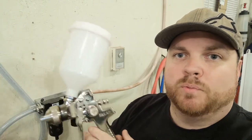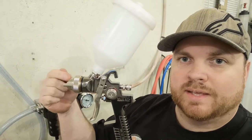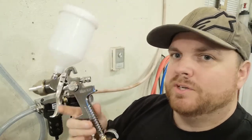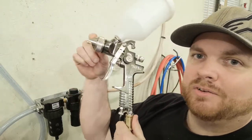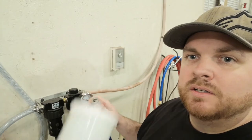Over here at the regulator now — she's sitting at about 44 psi. I don't even have the compressor on; I was gone for a few days and had it turned off. This will work fine for our purposes anyway because it's already above what we want it to be, around 30 psi. Most of the paints I've been working with — it says right on the can, or you can ask the person that sells it — want to see 27 psi at the cap. I haven't measured the actual pressure at the cap, but I know that if I have 32 coming in at my gauge it sprays nicely. Trial and error has told me that it's probably sitting around 27 at the cap, because when I do my test patterns on the paper on the wall it looks great. So 44 in here — I want to get 32 on the gun. Just connect my air hose.